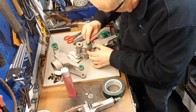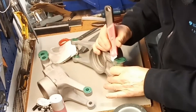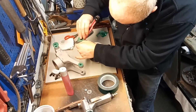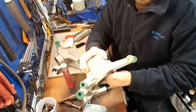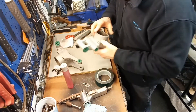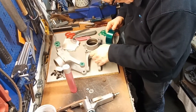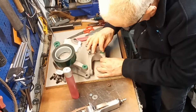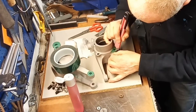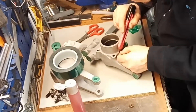As you can see from the bench, there's very few tools involved but it takes an awful lot of time. On the bench we've got a couple of very sharp knives, we've got the polymer high temperature tape which is the green tape. I'm going through and degreasing locally the areas where I need to attach the tape, making sure it's really attached really well, and then carefully removing the excess tape to leave the faces covered that I do not want powder coating.